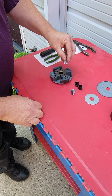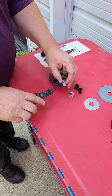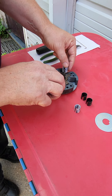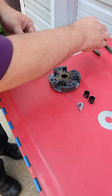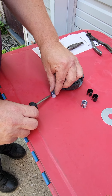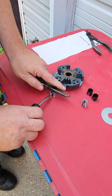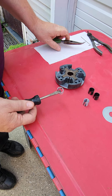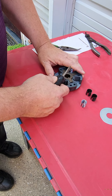There are two ways to spread the spring so that it goes over the shoes and holds them together. One is to use a pair of needle nose pliers and spread it apart — it helps if you have heavier tips. I'm going to do it the way I usually do: use a regular screwdriver and hold this down on the bench with just another tool so that it doesn't get away from me and possibly hurt someone or get lost in the shop. Gently spread that spring and it should slide right down into place.